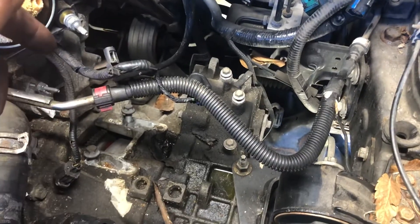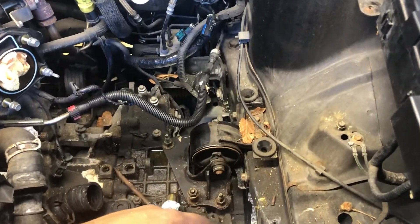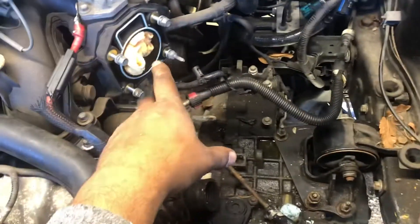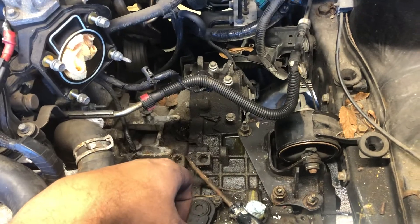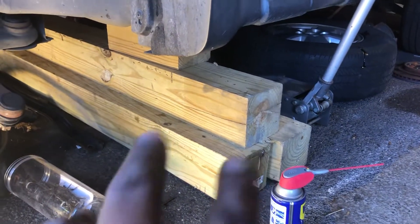Once you do this kind of work, you're going to need to clean out this area, remove the battery, air filters, throttle, and all that stuff to make sure you have easy access to the transmission. I'm working in my own garage. What I do is I got three posts — six by six — stagger them, and on the frame of the car I put one over there and one on the other side so your exhaust is clear.